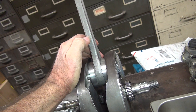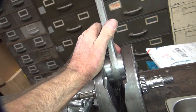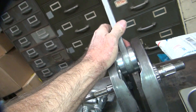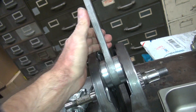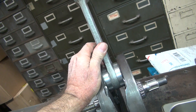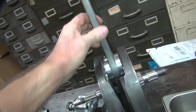I upgraded to the S&S and it broke a year and a half later. That's when my motor locked up at 135 miles an hour — I took out that bearing. After that, I took the other rod since I had two, went down to one bearing, and made spacers up in here to take up the slack. The motor doesn't know I only have one rod in there — as far as it knows, it's seeing two. I run them nice and loose.